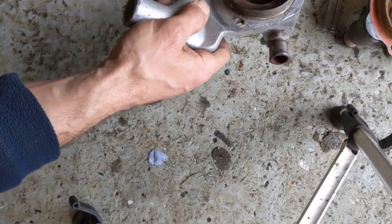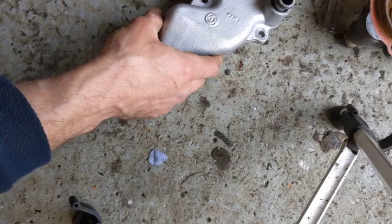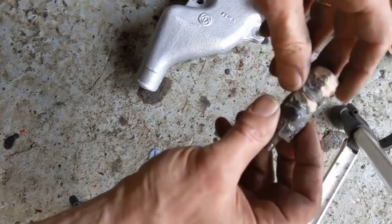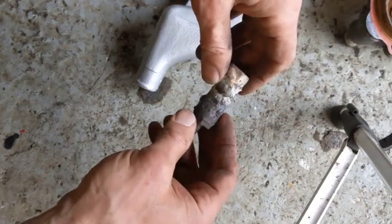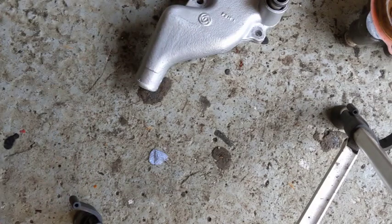In trying to get this one out, I have broken my slide hammer tool. So I can't get this out and I can't get the other one out any longer either. The threads have gone very slightly on the bottom of it. I have tried welding on new nuts to do it again but I am stuck. I welded a couple more nuts on here to get my slide hammer in there so that it would pull out, but it's just coming out on the threads now. Both of my water pumps are well and truly stuck.